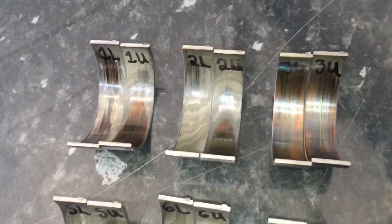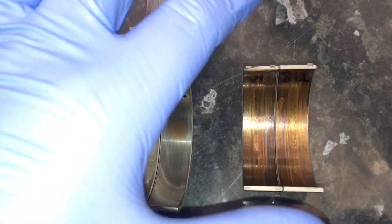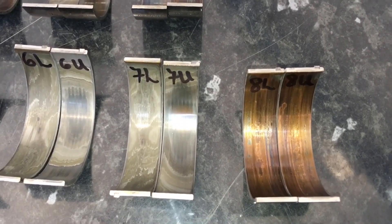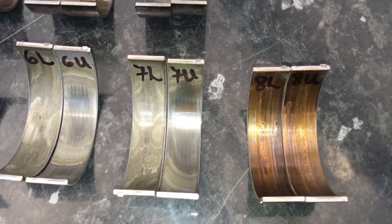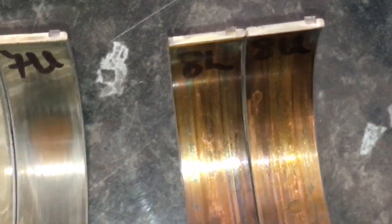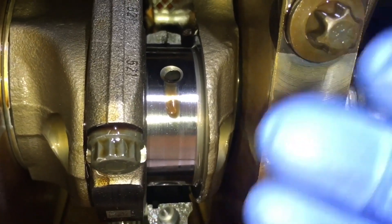What I thought was the end of the video — and what was a bad set of bearings in cylinder three — was almost nothing compared to what I've just taken out of cylinder number eight. Amazing that the engine was still running without any knocking noise. That is horrible to see — totally copper, not even any layers anymore. It's gone through all the top layers and now we're just seeing pure copper colour with issues, breakup, and scratches on the bearing.